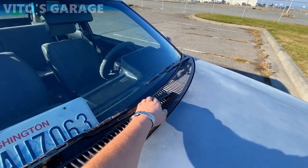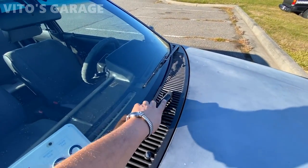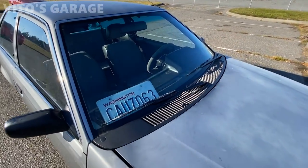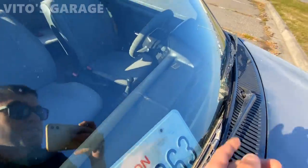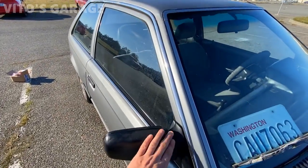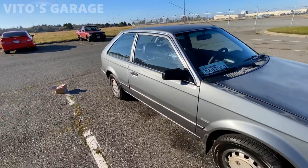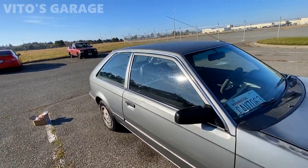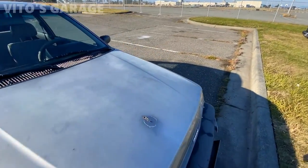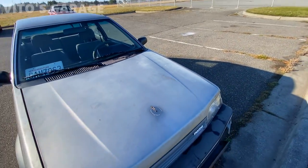I also took out the wiper arms, cleaned them, sanded them, repainted them, and reinstalled the wiper blades — those are still good and one is actually brand new. I also touched up the plastic trim with black trim restorer to make it look nice. Removed the roof rack — thank god that's gone — and the ornament is also gone. I need to put some grease on those holes so they don't start rusting.